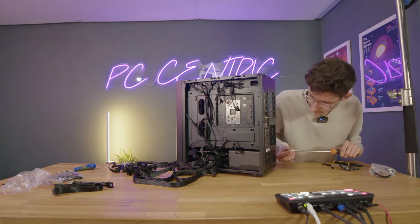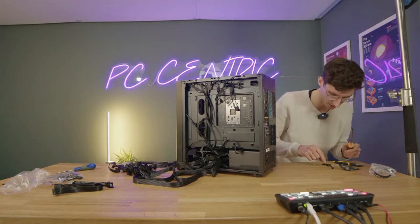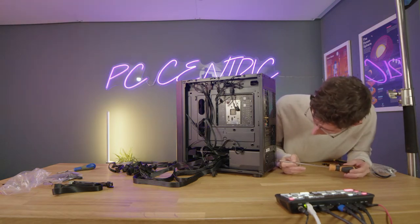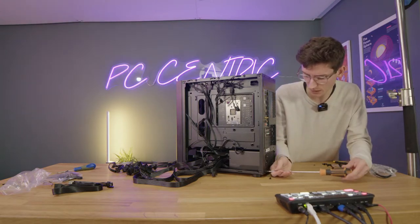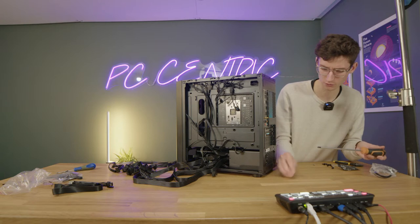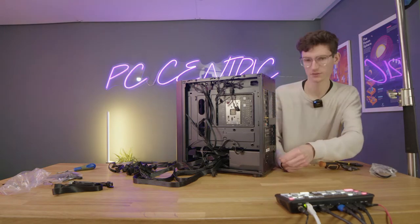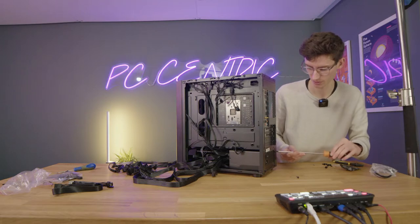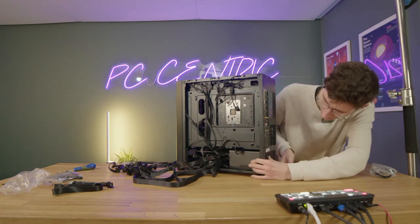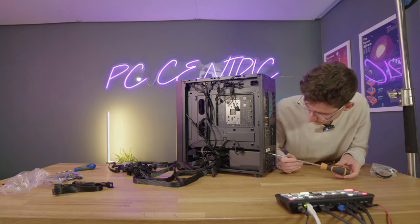But that is quite an out there combination, because those boards, while they technically will work, are not necessarily built to deliver loads of consistent power. So for gaming, you'd probably be all right. But if you're looking to use that rig for a load of other continuous strain applications, you might find that the longevity of the board isn't what you want, because they're not built to the same level of power delivery. I mean, it's fine. But I'm sure if you spoke to Gamers Nexus about it, they'd be able to tell you loads of reasons why they're not a fan of entry-level motherboards and high-end CPUs. I've not personally had any issues, but I just like to make you aware of it. I certainly wouldn't overclock or increase the power. Sorry, yes, I interrupted you.